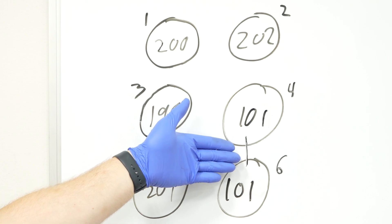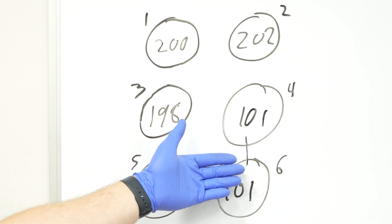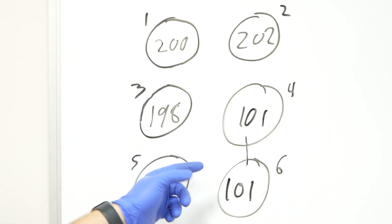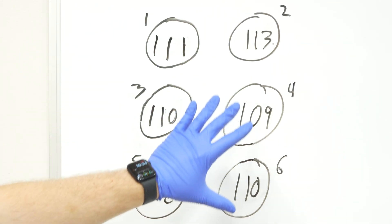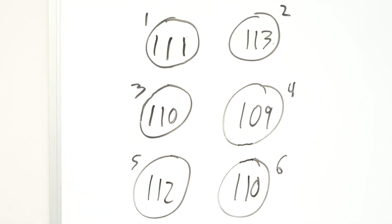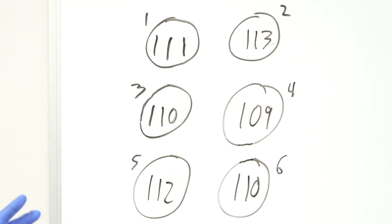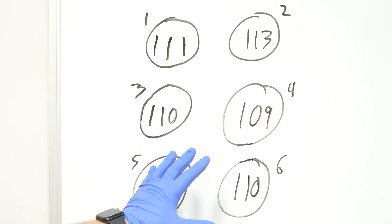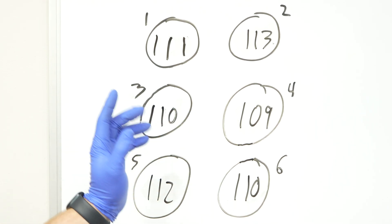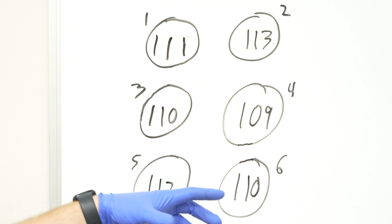Here's the funny thing about that head gasket problem — your engine will most likely test fine for a blown head gasket on all other tests, but this test says yes. There won't be any oil in the coolant and nothing will appear wrong, except there is a blown head gasket between the two. That's important info to know. The next scenario is you have a uniform engine but everything is pretty low. What we've found is the camshaft has jumped a tooth on the timing chain or timing belt. You'll have a camshaft correlation code that reads high or low, and you'll think the sensor's broken — but putting a new sensor in, it still reads high or low. That's because you have a mechanical problem where the timing for the camshaft and crankshaft are out of sync, which gives you low compression and the engine won't run right. The check engine light will never turn off, and you need to readjust your timing.